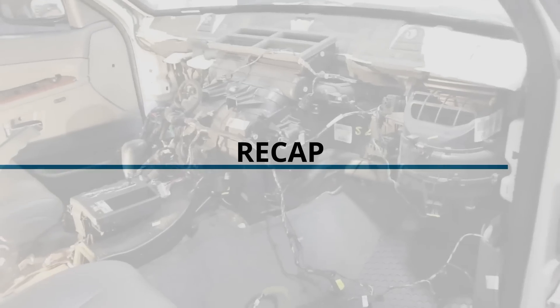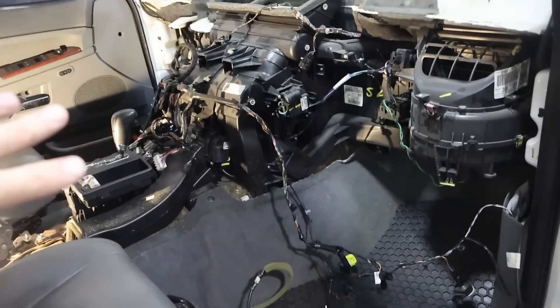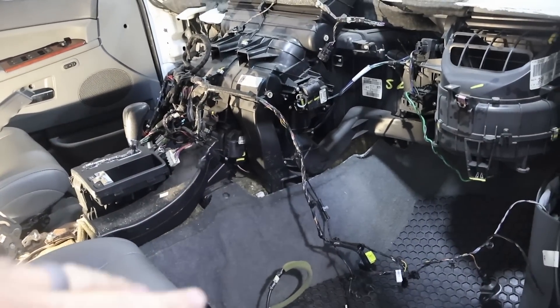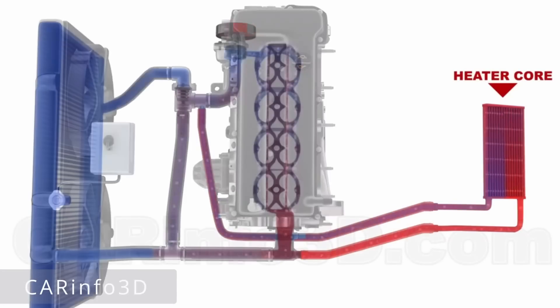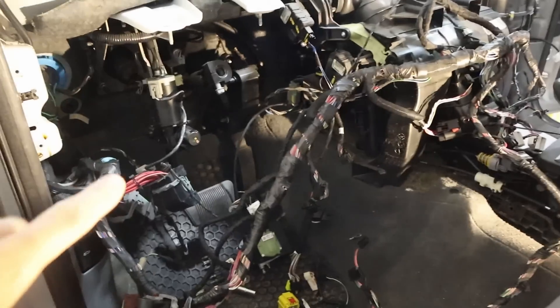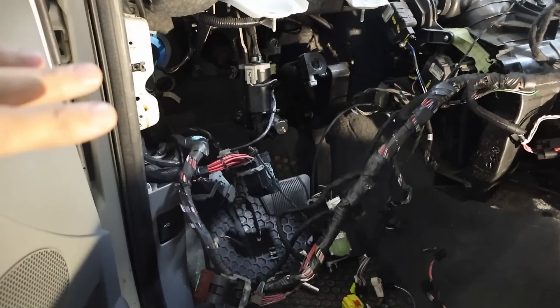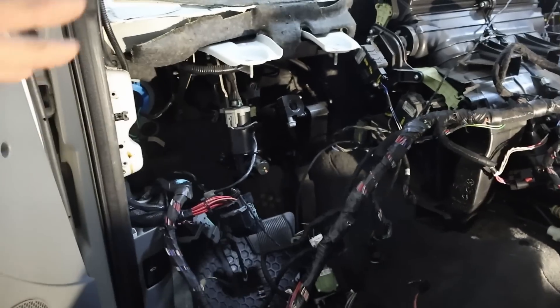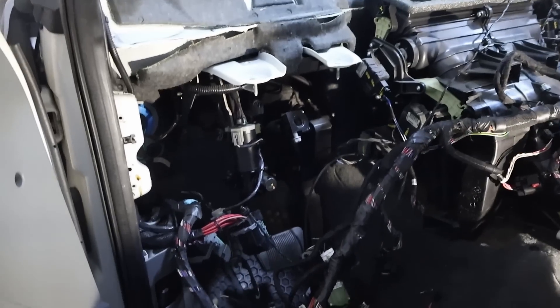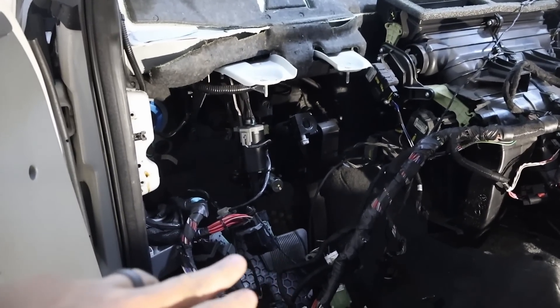We've got everything out that we need to get out — got things laid all over the garage, but I've been really impressed with our documentation and I think it'll go very easily back together. So we've got about all that we need for the interior. The heater core operates on lines going to and from the engine to produce heat, so we're going to take that out and put in an electric heater. On the driver's side we needed to get to the accelerator pedal as well as the brake pedal. We're going to do a Tesla brake booster and a Tesla accelerator pedal — we just need to get the precise pedal locations and have a good scan so we can create CAD for brackets and adapters.